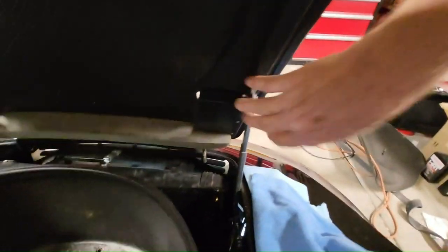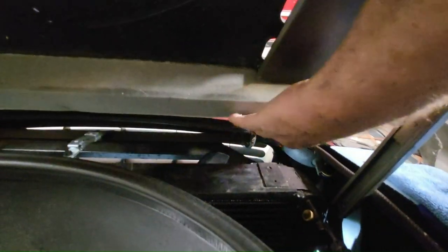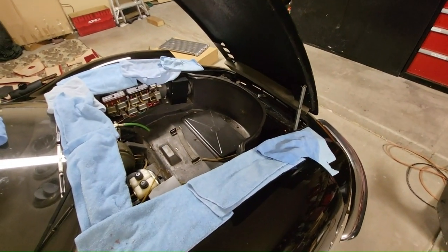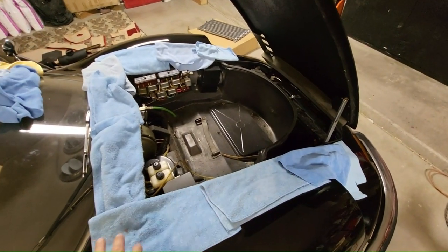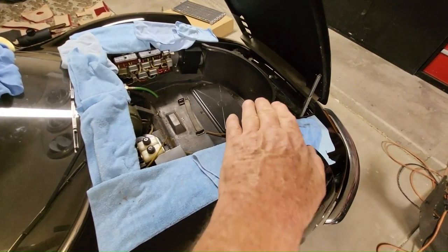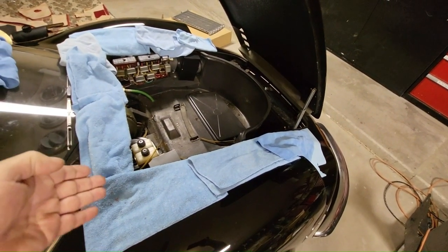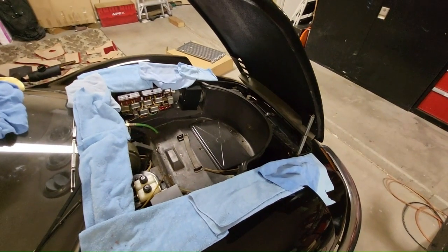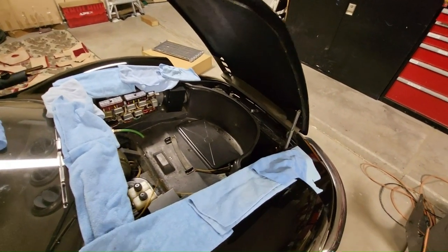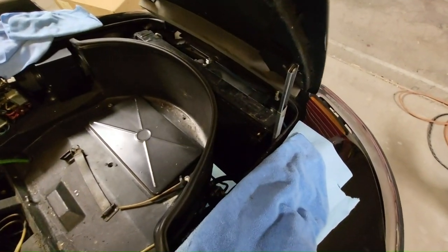Leave the stay attached to the hood and then unscrew each of the three nuts. The way I do this to remove the hood delicately: I've layered microfiber towels, and when you pull the nuts off the end, you raise it and leave the edges pivoted. When all six bolts that hold the hood on are removed, take it and put it someplace safe.